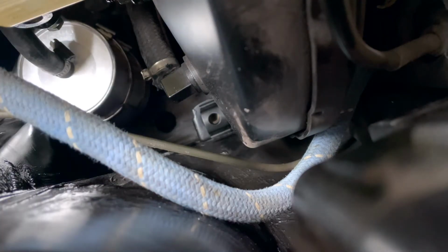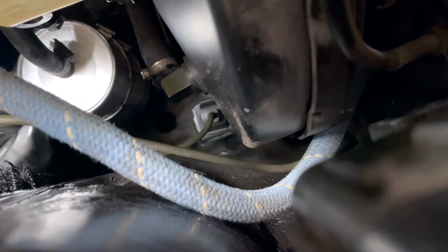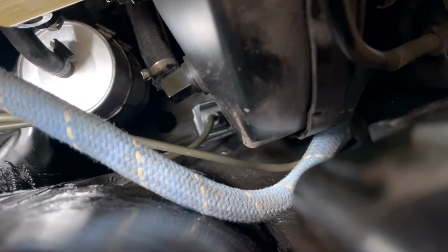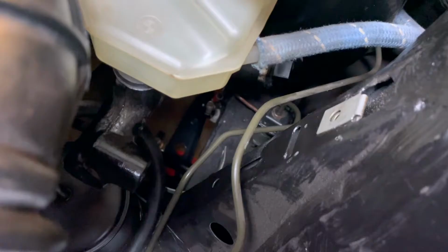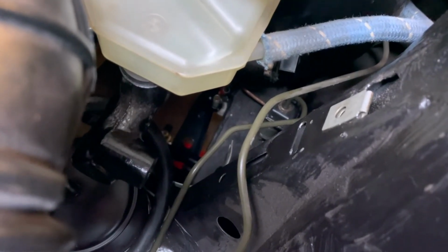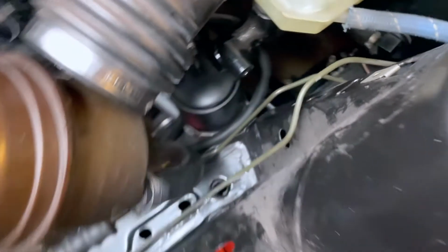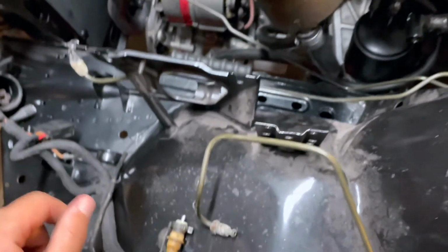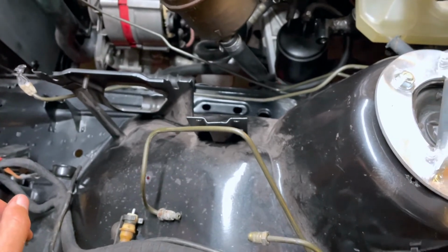There goes the clip. Now we take the line. Now we need to tighten it. How in the... So guys, finally managed to torque both of the lines on the reducer valve. Had to take off the fuel filter to get some room for the spanner, but all good. Let's continue here with the lines, and we will also put the ABS pump, and yeah, moving along really nicely.